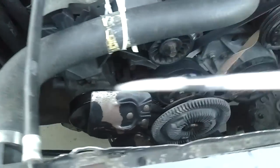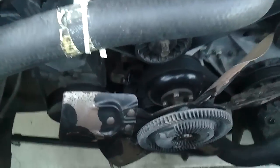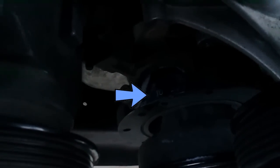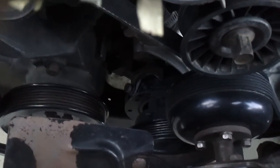I'm just using a little brush to paint the mark I was telling you about — the 10-degree mark. I think I got it. It's going to come up really bright as soon as I put the strobe on it. You can clearly see the 10. Those increments are every two degrees.